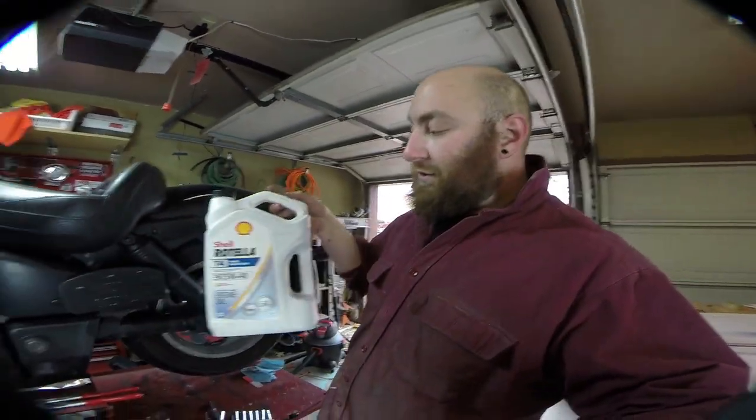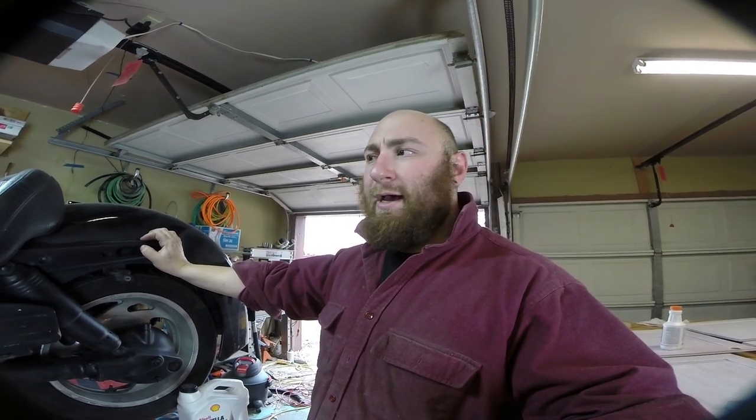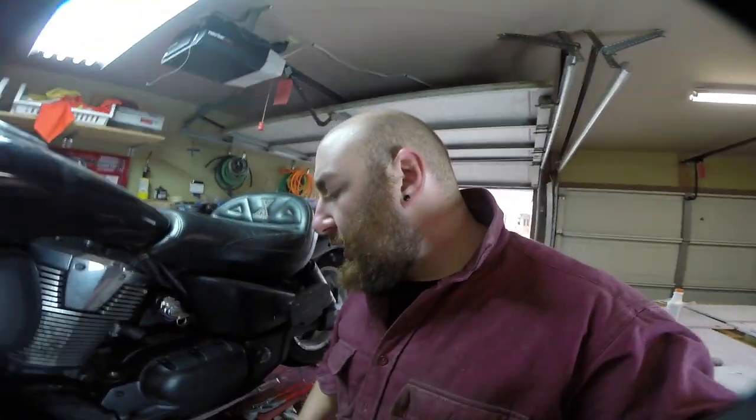I'll put a link to this filter down in the description below. Next up we've got to add four quarts of this stuff. This is what I use: Rotella T4 15W40. It's great — there are no additives or modifiers. I've been using this in motorcycles for probably at least a decade now without any problems on any of these bikes. Delo 400 and DelVac are also competitive products that work just fine in motorcycles. Just make sure you get the heavy diesel products — usually fine because there are no friction modifiers. This thing takes exactly four quarts so I'll just top her up and check it against the dipstick, and the oil change is done.